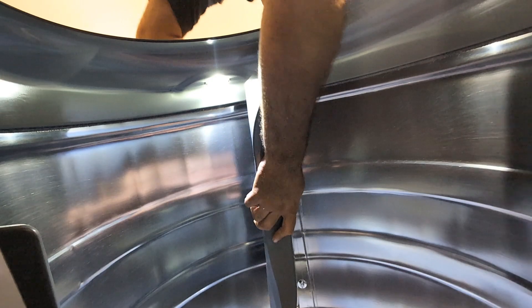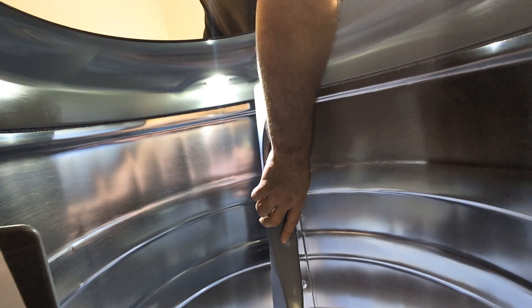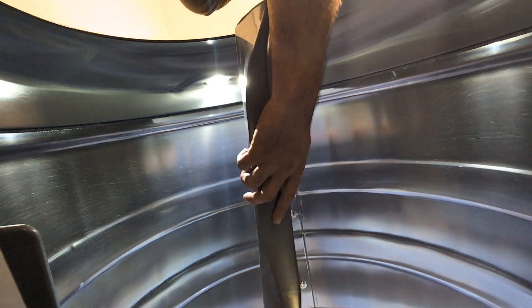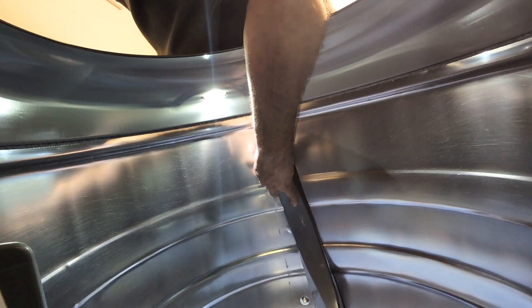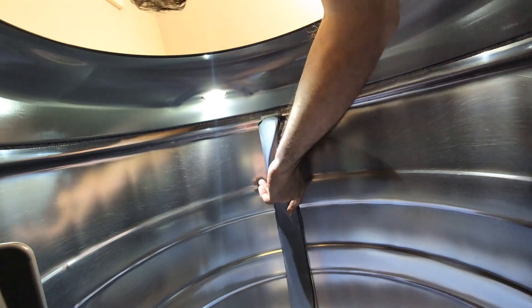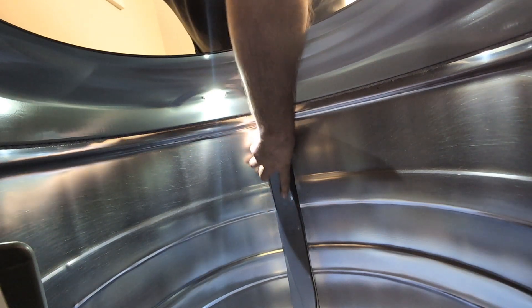In order to replace this, you have to work on it from the inside with one hand and from the outside with the other — of course you're looking at the screws and lining up the holes from the bottom to the top of the drum, which is outside. Once you add all three screws one by one, it's a little bit tricky because you have to line up the holes. Once you line up the holes and you can see the hole from outside, you can just keep adding your screws one by one — three Robertson screws.